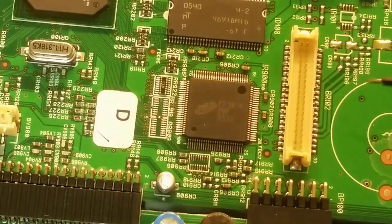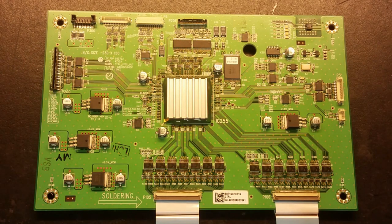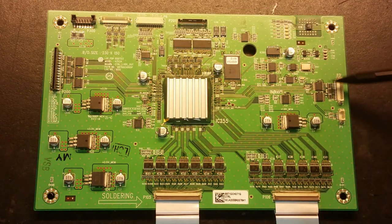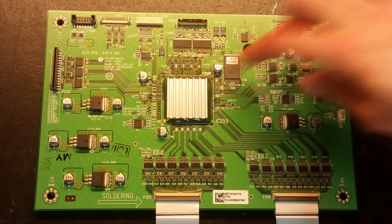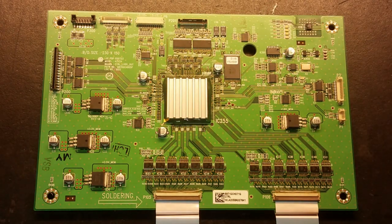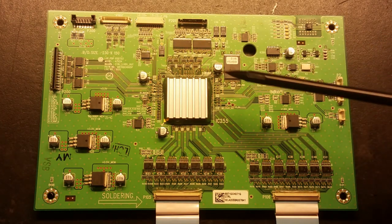Here we got the main video and audio processing unit — the Pixelworks PV118B — with flash memory, two RAM chips on top, and a little crystal. Here's a Silicon Image chip that controls the HDMI connector. Here's the main display controlling chip — it's a dual LVDS transmitter between the host and the flat panel display, with QXGA resolution. This transmitter converts 48 bits of 24-bit color dual pixel TTL or CMOS data — a pretty interesting chip, the EP387A. It takes the signal from the main processing unit out through this wire to the logic control board.